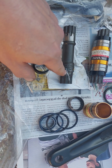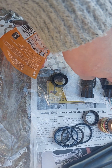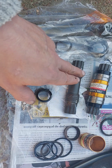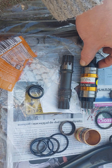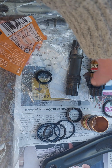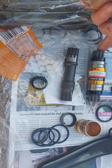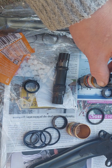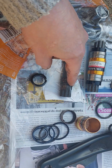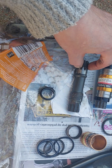In any case, I cut it open to see what it's like. On the left-hand side there are cartridge bearings — these run directly on the axle, and these are always the ones that fail. Incredibly bad design. You can't really fix them. If this aluminium part were easy to take off you could just replace everything, but you can't — they're very hard to get off. You need to cut off one side, then you can get these off, remove this, put it in a vise, and hammer the axle out. That's not a problem, but there should be some kind of screw mechanism — there isn't. This is just an incredibly bad design. It doesn't last long, and it has tiny bearings. You can't replace those bearings because you can't get at them without doing something destructive.